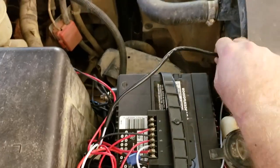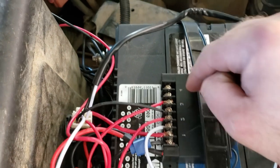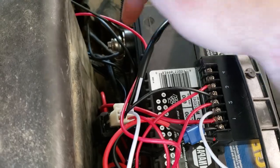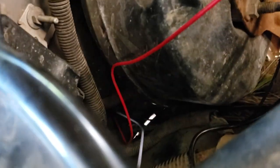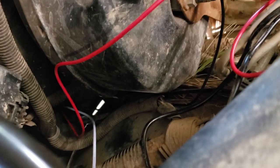So the wires come in from the lights right to here, which connects to this relay. Then this relay gets powered by this four-port power switcher, which allows the driver to have a remote switch as a key fob. After that it goes to wires that get fed to the negative and positive posts of the battery. Then it gets fed to this remote wire — you can see I've got it wire-tied and tucked back behind the fuse panel, and it feeds down through there and goes through the firewall into the cab of the truck. At that point it terminates at a switch that the driver can manually use to turn the lights on and off, so it doesn't accidentally drain their battery. Pretty good setup.